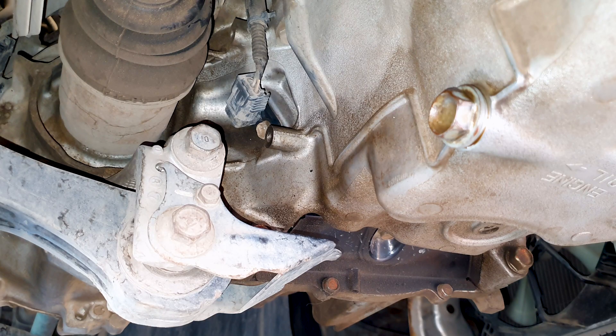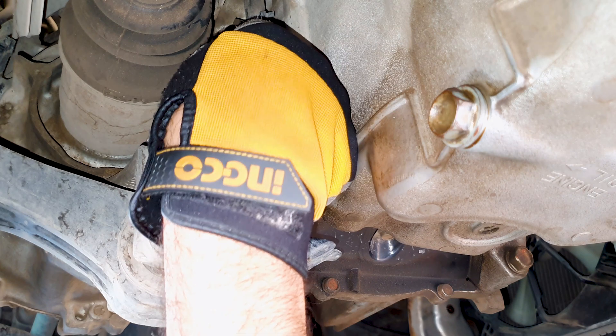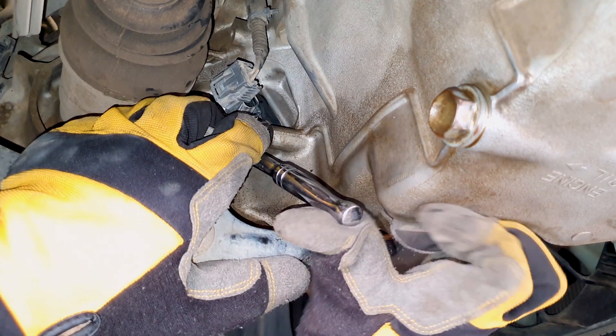Here I am under the car, and I have the car lifted from the front on jack stands. I'm doing an oil change at the same time. You do not need to drain the oil to remove this sensor. Here you see the crankshaft position sensor. On the Jazz, and even the Fit, you may have a cover that covers this sensor, which is held by two 10mm bolts. Here I have direct access. Unplug the connector and remove the sensor — it's only held by a single 10mm bolt.